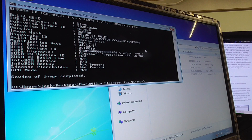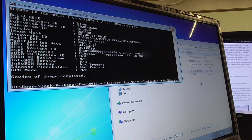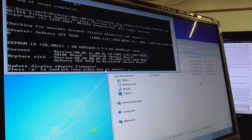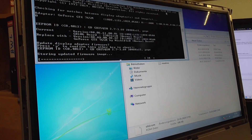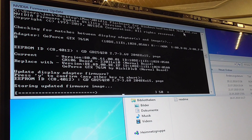Now here we go for the real stuff — we flash. All we have to do now is select 765M EG2.rom. I'm going to do it. Press Y to update. Error: write protection enabled. It's doing it now — I just had to enter 'protect off' first. That was all.